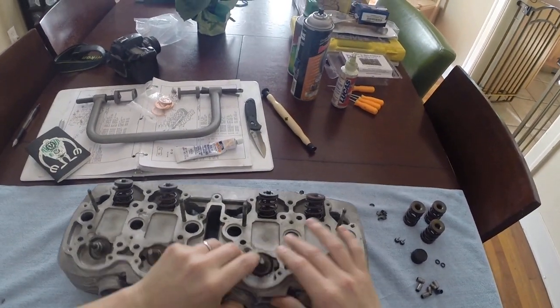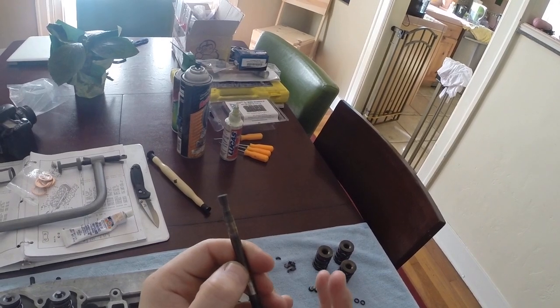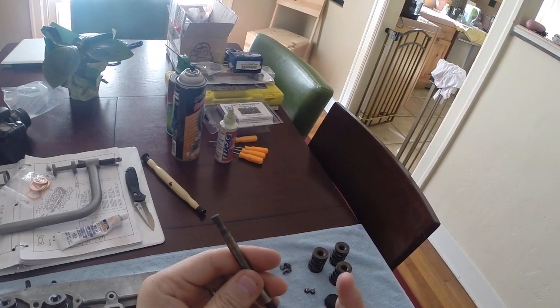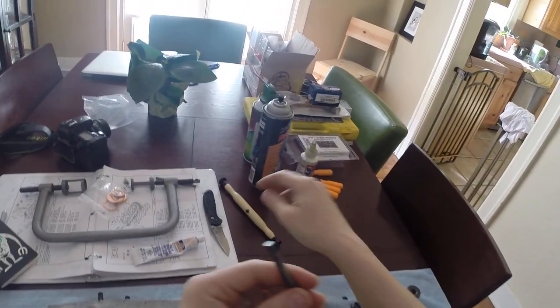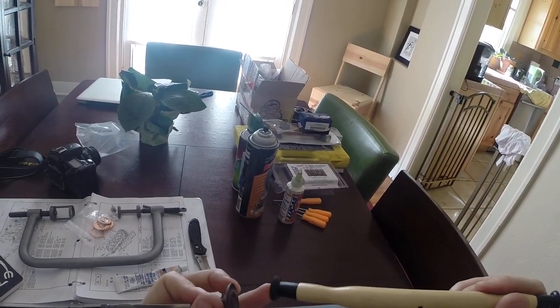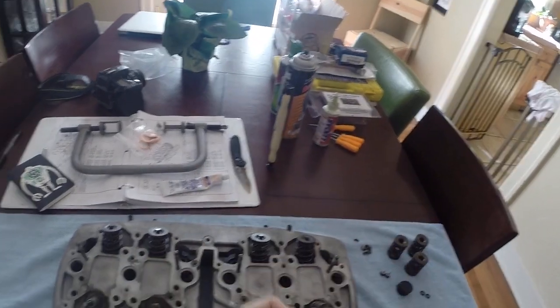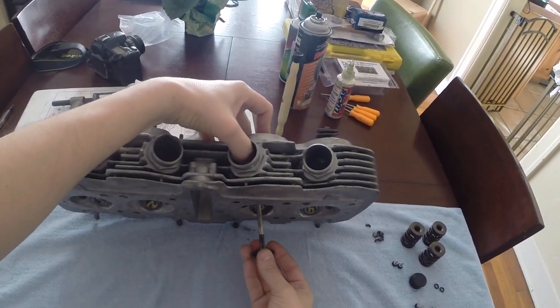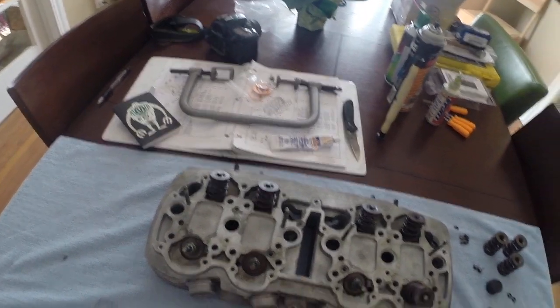So when you do it, here, I'll take a valve out and I'll show you. I'm gonna put this on my head here. Go ahead and find an additional space or a piece of plastic, and then just put the valve compound just on the seat like this. You should probably have a pair of gloves on. It makes it a lot easier for two reasons. First, it's a lot less to clean up and you concentrate on seating the valve correctly. But the other thing is when you use the actual lapper, no valve compound gets on the top of the valve, so it allows the lapping tool to stick a lot better to the top of the valve. It's gonna take a lot less time, it's gonna be a much cleaner job, and it's ultimately a lot better. So that's just my advice on lapping. And there's 100 videos on valve lapping, so I'm not gonna add one here.